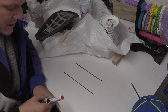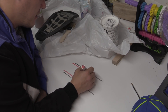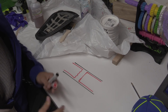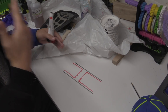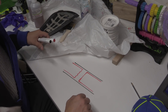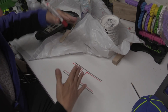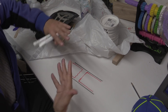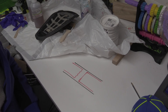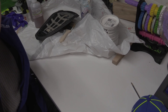Which usually causes the rings to die prematurely by snapping. If you look at a ring that's failed, it'll snap in its groove - you'll have the ring groove like this, and the ring is just cracked. If I got two pieces of wood and made a ring groove, you couldn't easily snap a piece of wood in there like that - it's cracked because of this resonance. The ring is whipping and twisting, doing all sorts of horrible things. There'll be a weak spot somewhere, a crack starts to propagate and it's done - basically cracking through vibration. Hope that makes sense and I'll see you in a bit.